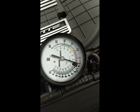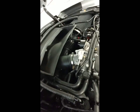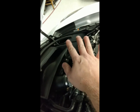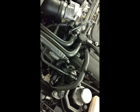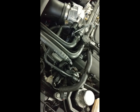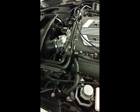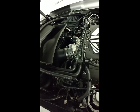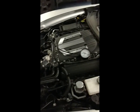You'll see I'll cover this back up to close the system back down, and this is going to start to creep back into vacuum slightly. Like I said, it's barely any, but that's just the way the stock PCV system works on this. So that's about as extreme a situation as you can get on about as expensive a motor as you don't want to replace. If I would have had the speaker over there, you'd have heard the air flying out. Obviously it's got to go somewhere. So there you go — this is the C7-Z06 wild kit 10AN inlet, which includes the PCV assembly to control the vacuum assist on the crankcase. That's the same basic assembly you'd find on any of the wild kits on MightyMouseSolutions.com, or we can build one separate for you, and we can do it with the recirculating top now. I appreciate your time — feel free to write, comment, ask any questions. Thank you very much.